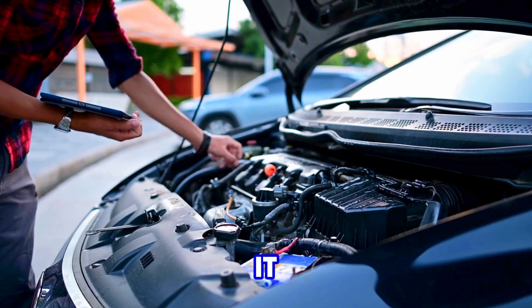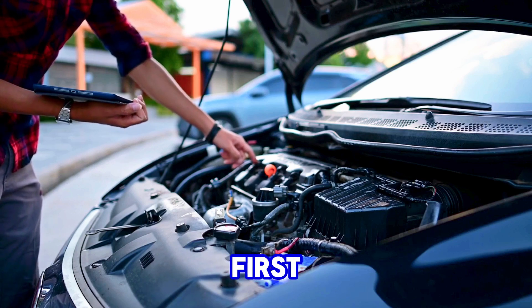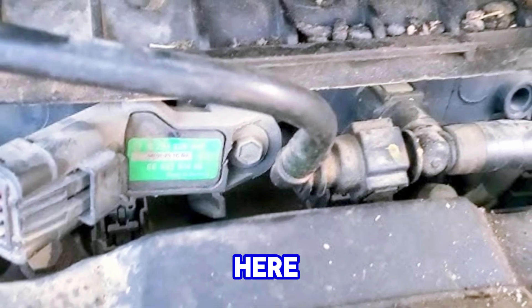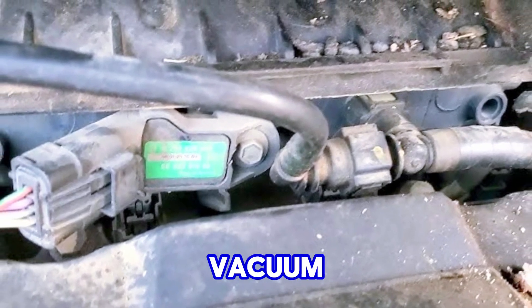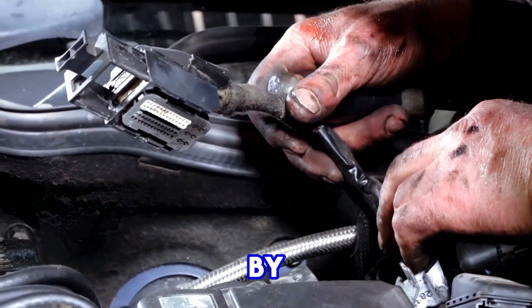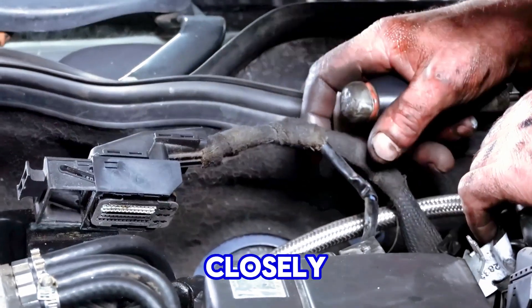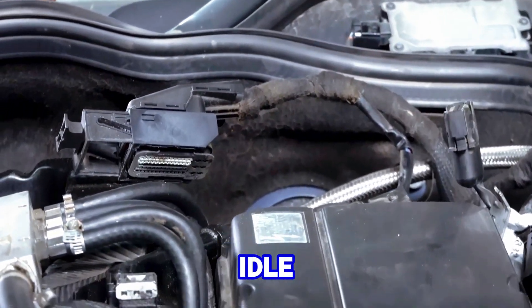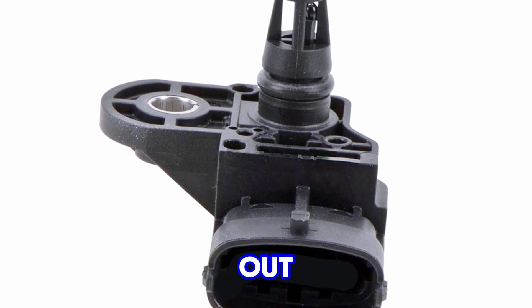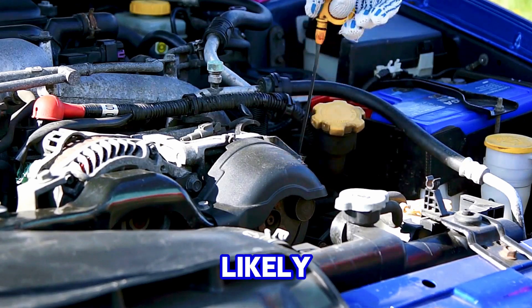Here's a quick way to test it using just your hands and a vacuum pump, or even your mouth. First, locate the vacuum line on the MAP sensor — that's the key here. If you have a vacuum pump, great. Start by applying a little vacuum to the sensor. As you pump, listen closely for any change in the engine idle. You're looking for a smooth response. If the engine smooths out or changes its idle, that's a good sign — the sensor is likely still functional.